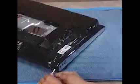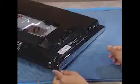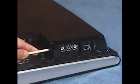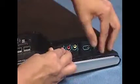Remove the rear side trims by prying up on the bottom of each panel. Pry off the optical drive cover. Press in on the side tab of the game console bezel cover and remove the cover if a game console is present in the unit. The back cover has 13 screws holding it in place that will need to be removed.